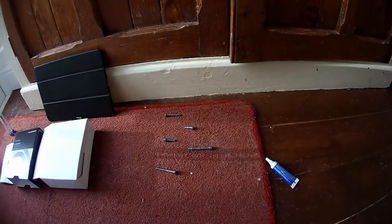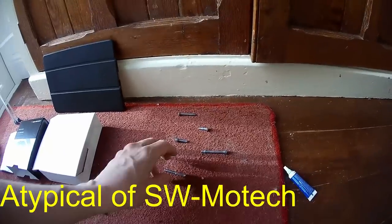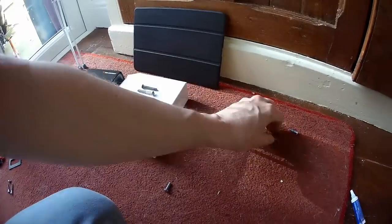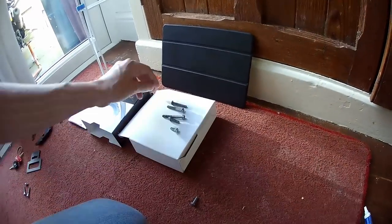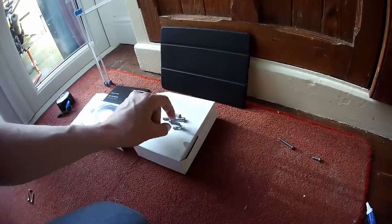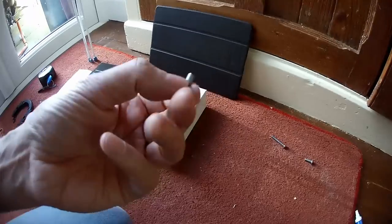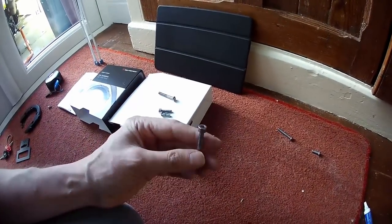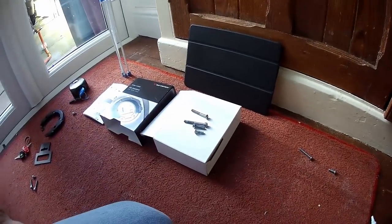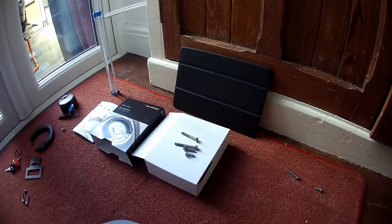I had it on the side stand when that screw fell right in behind the radiator — I had to use a magnet on a stick and it took me a good 20 minutes to get it out. So put something down to stop screws falling. Another annoyance with this piece of equipment: unlike SW Motech they don't provide you with any allen keys. Also they provide a screw you don't need, and the screw that was supplied was knackered and wouldn't work, so I had to purchase a replacement. They are two different sizes — that's 4mm and that one's 3mm — so you need two allen keys to fit this. Nothing insurmountable, just annoying from what you'd expect to be a high-quality piece of equipment.